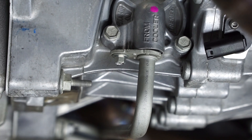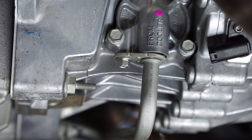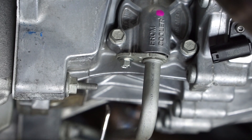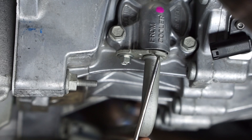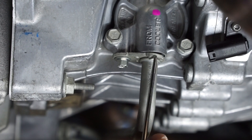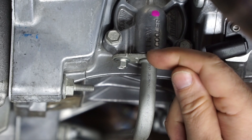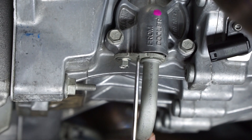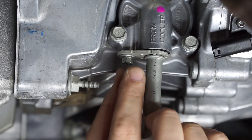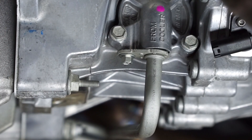Before we pull these out, I'm going to go over the whole idea behind the seal fixes — why they leak and do what they do. If you look here, you have a single bolt flange that's attached to your hard line. This flange, whenever it's installed on the line, they shove it on and crimp basically around it, creating a tight mount for the flange against the line. The reason they leak is this flange ends up being not quite straight or parallel with the line. Whenever this eight millimeter bolt is tightened down, they're not square — that's why some cars leak and some of them don't.